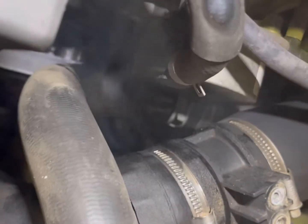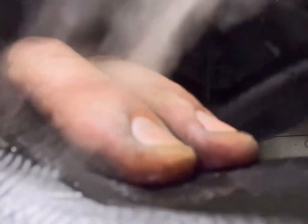So this is how the smoke is coming out. It's been running for a minute or so and we look down in here — I'll flip the camera around and I can see the leak. It's actually a split intercooler hose. You can see it there — so there we have it. It's just split the intercooler hose, so we'll just replace this intercooler hose and get it back on the road.